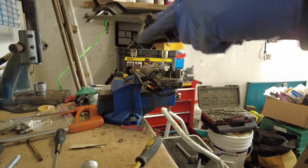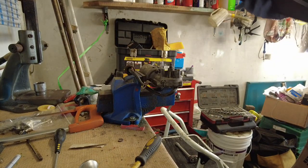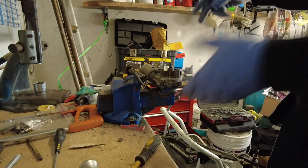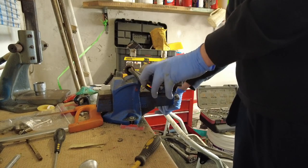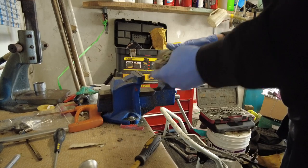So the two spindles are in much better order and we have the crank for the wiper arm — we'll put that aside. The reason I liberated the motor from that assembly is because this motor is what I'm going to use. What I want to do is crack the back housing off it and lubricate everything inside, because I have a funny feeling that's the reason why it's turning slowly.